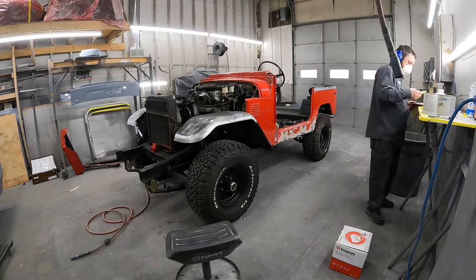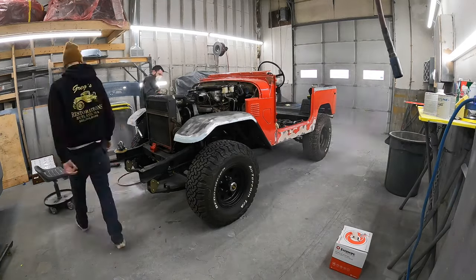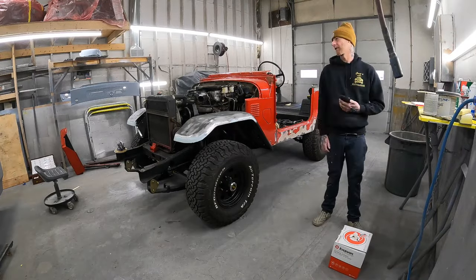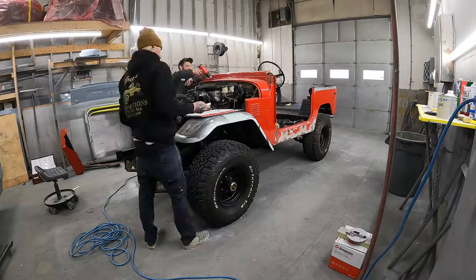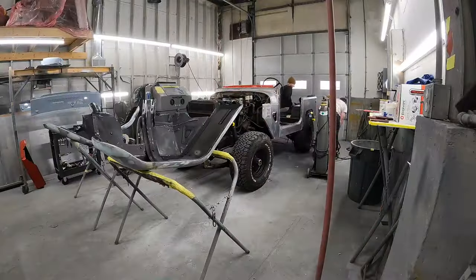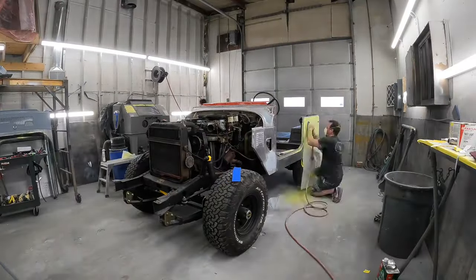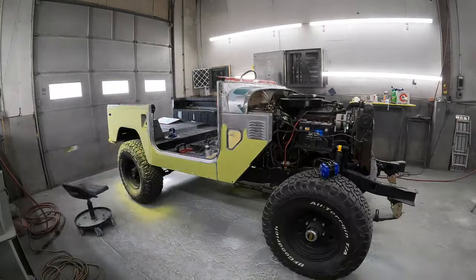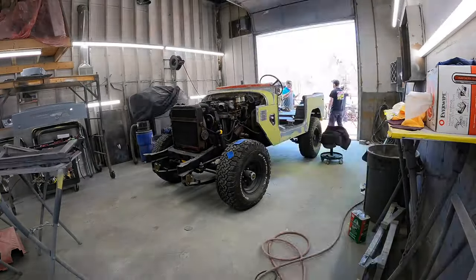We made this vehicle straight again. We did add an aftermarket set of front fenders — FJ40s are common for having rust issues, so we wanted the seams aligned up pretty well, and we fit a set of aftermarket fenders to the vehicle. This vehicle was painted red previously with a poor paint job — it looked decent, but a lot of the factory hardware had overspray on it, so we spent a lot of time cleaning and reassembling parts.